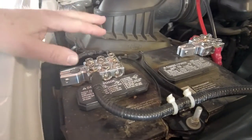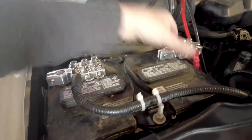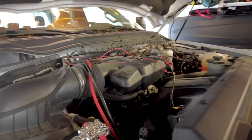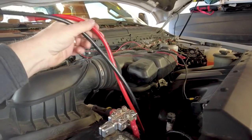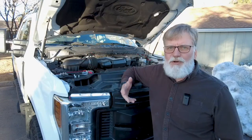On the negative side I have a similar crimped connection, but I do have some extra wire. Rather than trying to tear it apart, I'm just going to cut the wires, strip them back a little bit, and crimp on new lugs that'll go onto the terminal. I now have the terminals in place and have restored the OEM wiring on both the positive and negative sides. The next step is to reroute my accessory wiring and shorten the wires coming from the winch, then hook everything up.